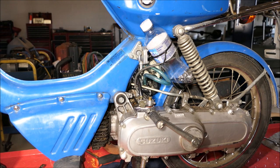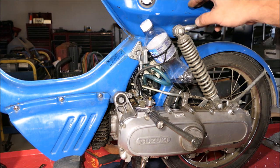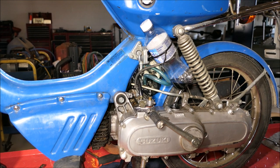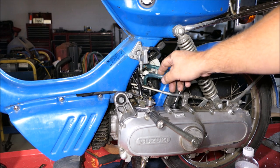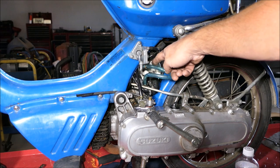Reaming out the jet fixed this motor ped. Before the test run, I wanted to show you a couple of things. I have a catch can here — the reason is that I mixed the oil 50 to 1 and put it in the gas tank. This is the oil pump; I just wanted to make sure it was working. It's been running all this time and there's oil in there, so the pump works. I'm going to hook it back up and run straight gas and straight oil in the tanks where they belong. Also, the fuel line is in a circle because going straight down it was pinching when you sit on the seat — the engine comes up and kinks the line — so the circle works well.